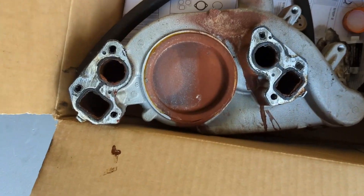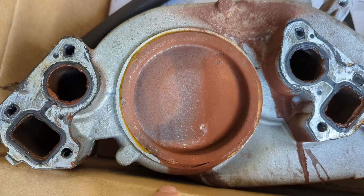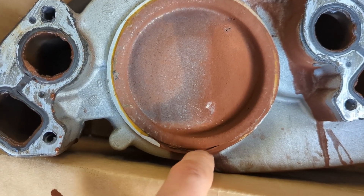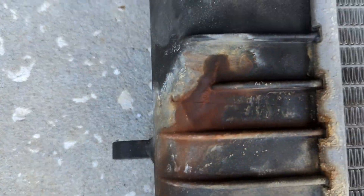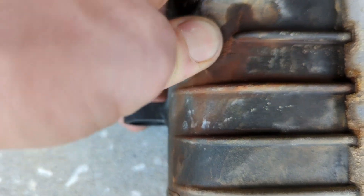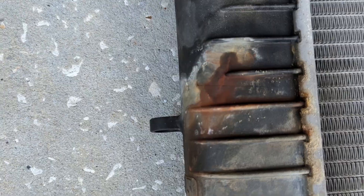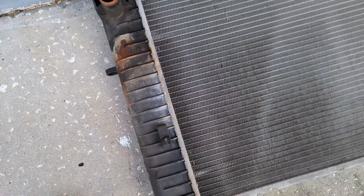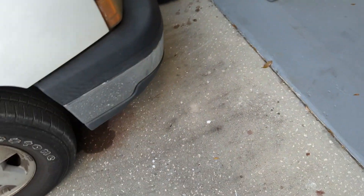Take a look here at the old pump and we can see exactly where it failed. This cap on the main housing — you can see the seal actually blew out from it. With the radiator, there's a very very small crack — not that big of a deal, but if I pressed on it, I could see the buildup there kind of flexing. So I went ahead and replaced that too, because it'd be a shame to do the water pump and all that and then just have something else fail.